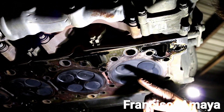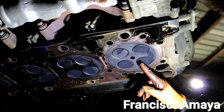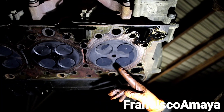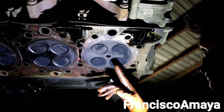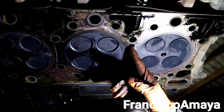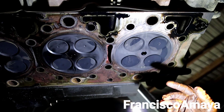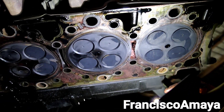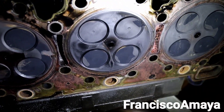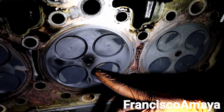Under the head over here, you can see the round area of the cylinder, you have the valves and everything. We see there are no problems on this one — it looks nice. But you can see a lot of corrosion right here — that happened because of the same thing, water. We go to the next one: everything looks nice and clean, no problems there. You can see some water marks probably here.